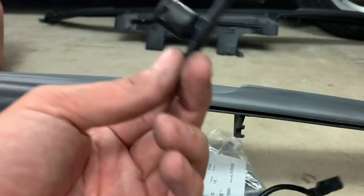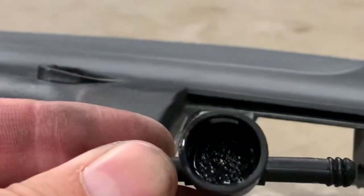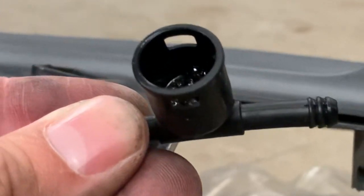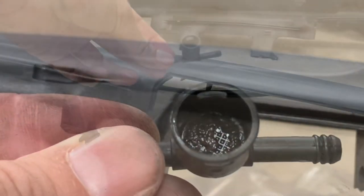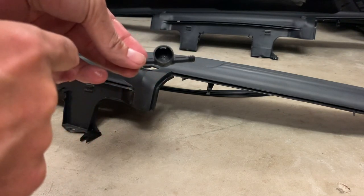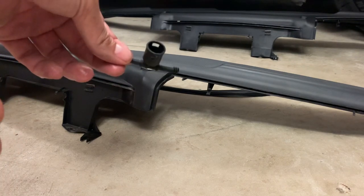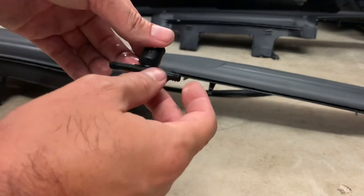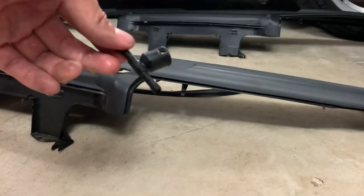Just pull up through those holes. I noticed inside there's like a screen and that screen is a bit gunked up, so you might want to give it a little clean at this point - just put it under the tap and flush some water back through it to wash off any gunk. There's quite a bit of debris in there. That little screen comes out - make sure you don't lose it down the drain like I almost did. Mine is really clogged up, so I'm surprised it was spraying at all. Definitely take that out and give it a clean. If your washers aren't working well, even if you're not doing this job, you can easily take that out and tidy it up to get your windscreen washers working better.